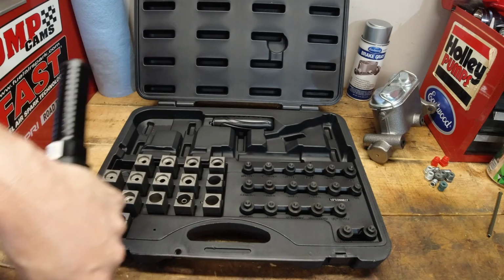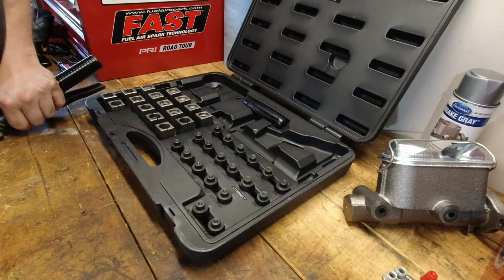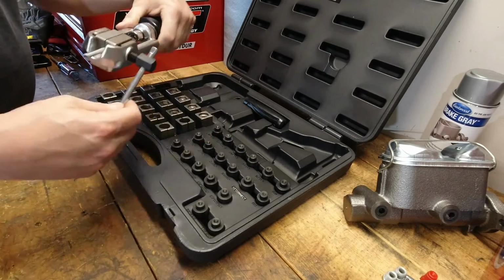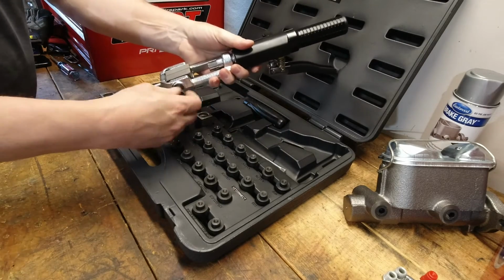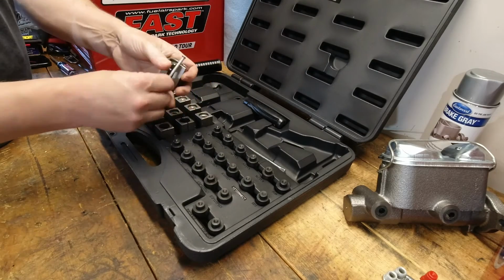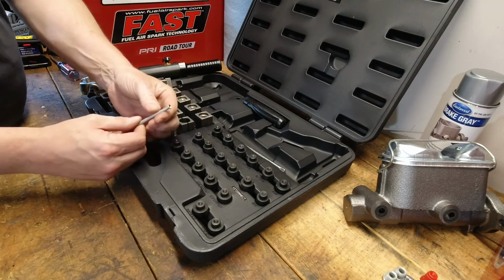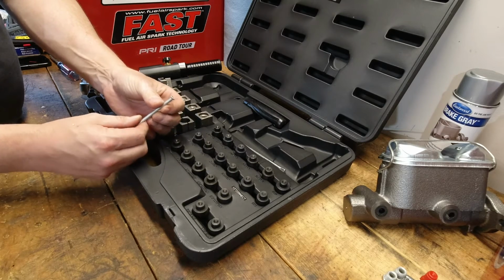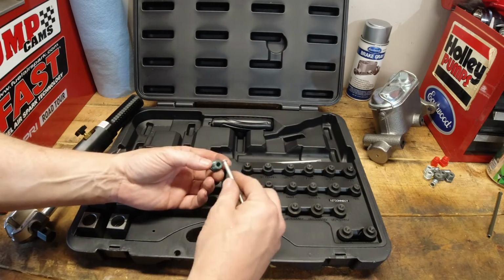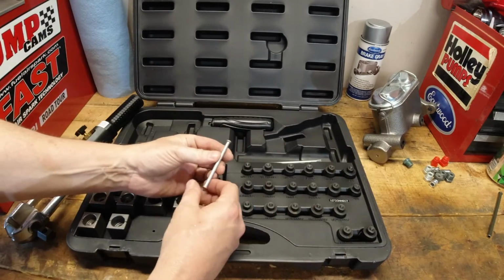So that's a huge benefit in this. The other thing that I liked is, again, I like all the different dies that are in there, but it follows kind of like those very high-end kits. In making a double flare, there are 3 different dies that are used here, and I've seen some of the other cheaper ones that are a 2 die setup where you just flip the die and get one side for one of it, and then the other side creates the other thing you need. And I really like the fact that this one uses 3 different dies. Very, very nice, very, very complete kit.